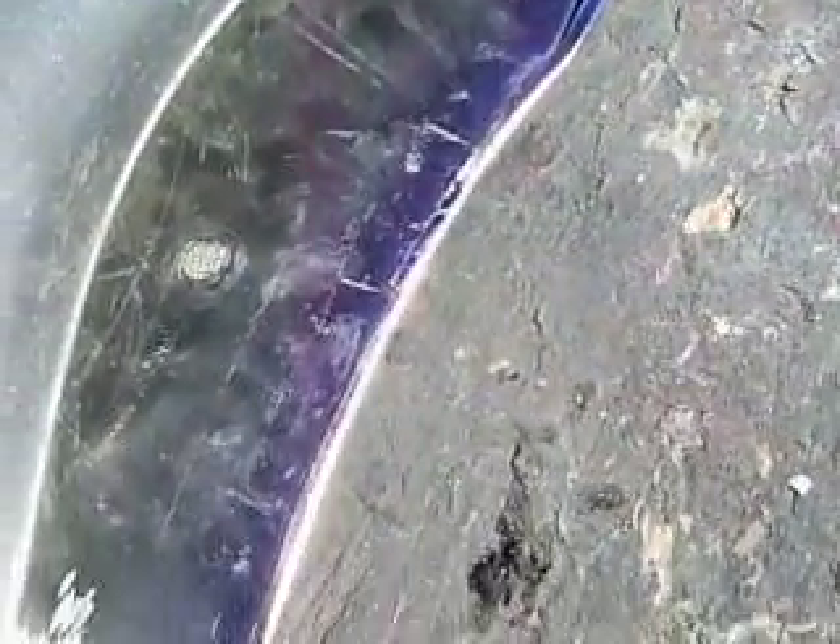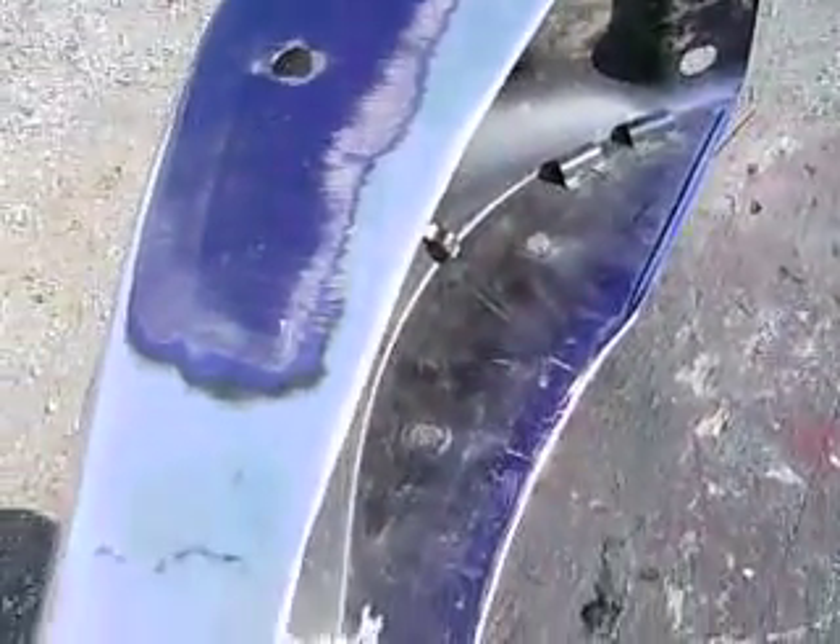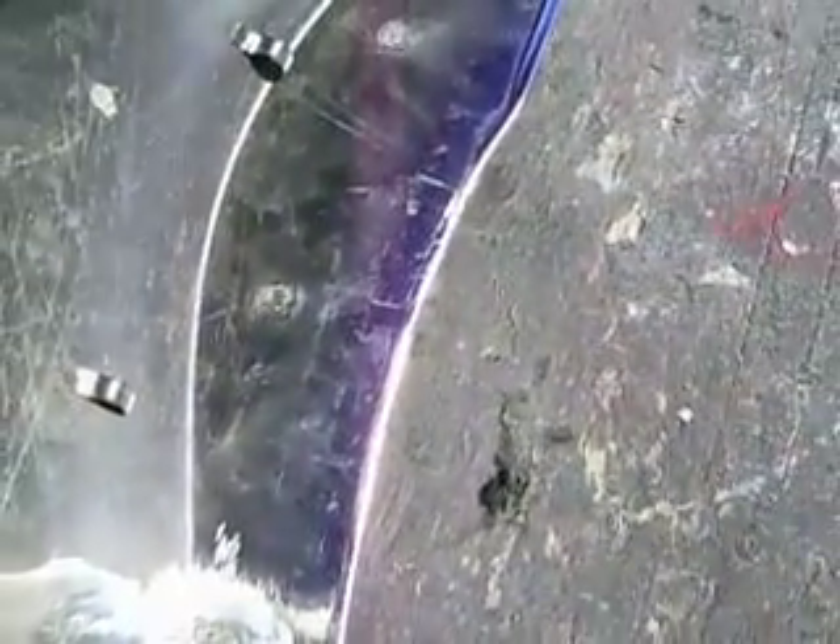Not exactly easy, but it was mandatory to get the correct edge look, to get that line in the correct bead. You can't just hack off the metal and leave it uncrimped, you got to crimp it over. So I replicated the original crimp. Because they didn't meet up right here, they were about an inch and a half off, so I sliced off about a quarter of an inch of the metal and then re-bent it using a piece of angle iron, a couple of vice grips and a hammer. I just bent it over 90 degrees and then smashed it flat on my anvil, on both sides, same thing over here.